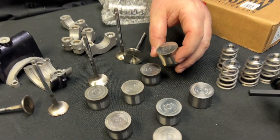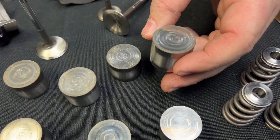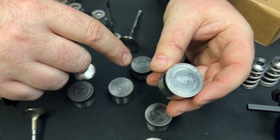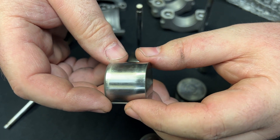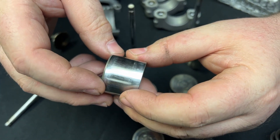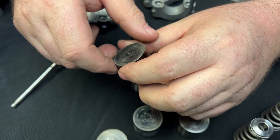On the buckets, we see pretty much what you always see in all these failures online — the bucket really got torn up. This thing has like six hours of runtime and all the buckets got torn up. Everybody pays attention to the top of the bucket because it's the first thing they see, but the side of the bucket really shows the metal-to-metal contact transfer. That is only possible because there was no viscosity in the oil — the oil is contaminated — and you can really see how this messed up the camshafts.